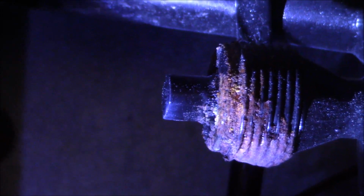See that white smoke coming out of there? Very faint, but it's coming out. Where the sulfur meets the ammonia, it turns into ammonium sulfate. And there's where your leak is, right there on your stem. You can barely see it right in there. But over a period of time, it's going to drain out, and then your refrigerator's going to be dead. Yep.